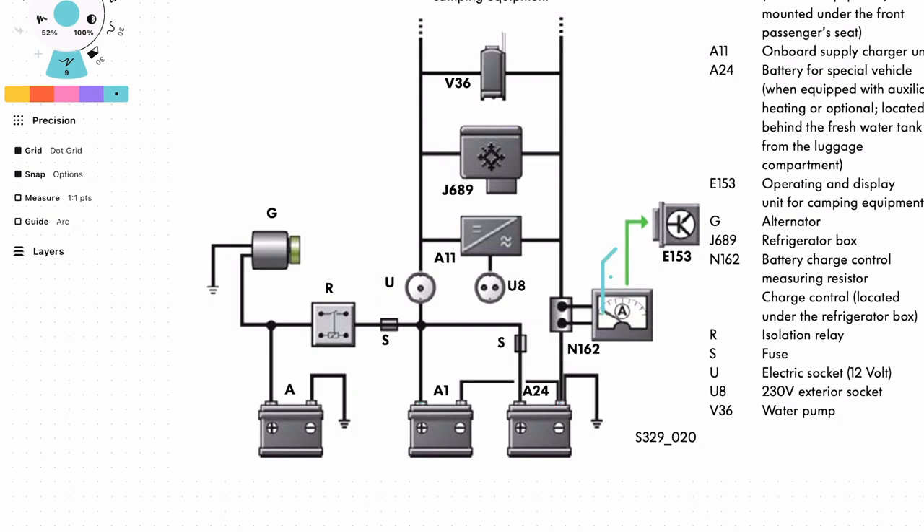From the positive of one leisure battery and the negative of the other, all of the loads on the camping side are powered: the water pump from the water tank, the fridge unit, the inverter-charger that charges the batteries when you plug the van into mains power on a campsite. There's also a power meter that sends the current being drawn from the batteries to the original camping controller. Volkswagen have quite rightly done this — pulling the positive from one battery and the negative from the other — so that the loads take power equally from both batteries, not more from one, which would lead to a shorter lifespan.